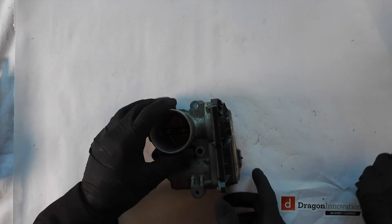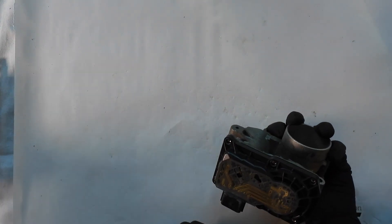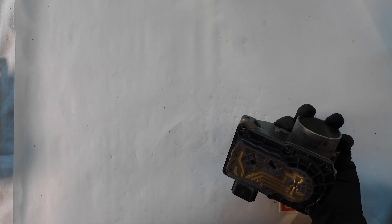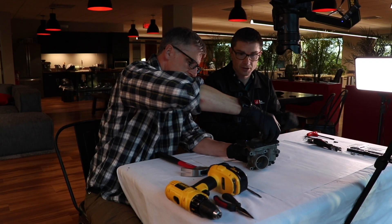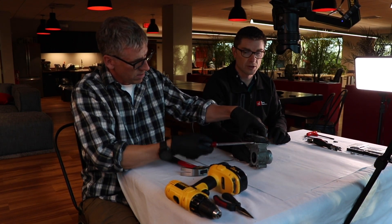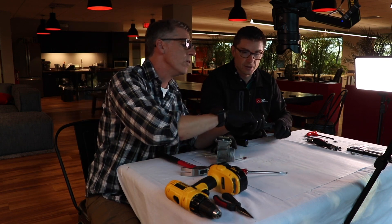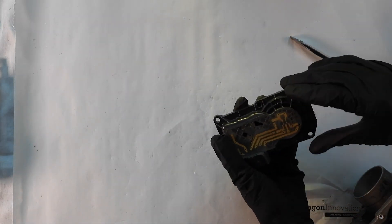So we're back. What did you do last night? I took this and put it on my belt sander to expose the electronic leads, as we suspected. Looks like they were overmolded — totally waterproof. So we can see those two leads over here. There were six leads total — let's pop this thing off. Here are the two leads for the motor, and it does have six other pins, so four are going over to the sensor.